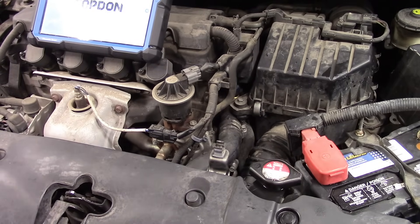The first thing I like to do anytime we've got temperature issues is get a baseline. I've let the car sit overnight - it's chilly in the garage. Whatever the temperature is in here, every temperature sensor in this car should be reading pretty much the same, within just a few degrees of each other. So let's get the scan tool on there and do what I call a temperature rationality check.